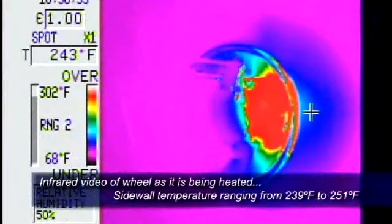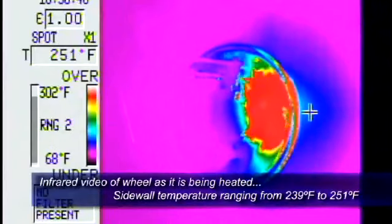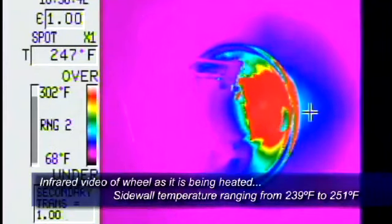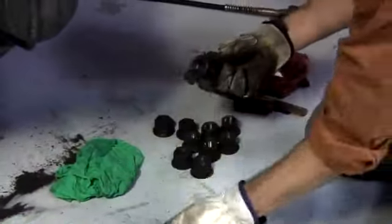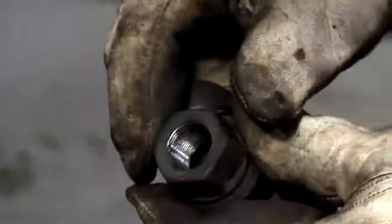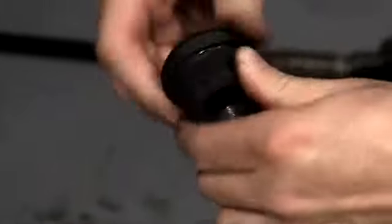Heat from the torch is transferred to the studs, wheels, and hub, which can cause irreversible damage to the components, such as melted wheel bearing seals or burned tire beads. That's why technicians must carefully clean and inspect all of the components, including the studs and fasteners. Always look for any damage, corrosion, or wear before installing the wheels. On hub-piloted wheel assemblies, apply 2 to 3 drops of 30-weight oil on the last few threads of each stud and between the nut body and the flange. This will help ensure the proper clamping force can be reached.